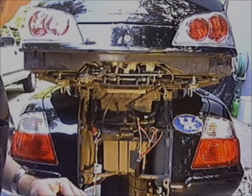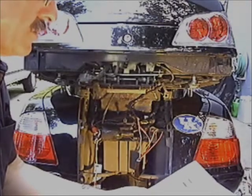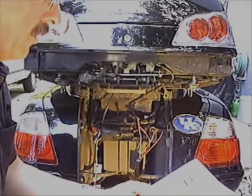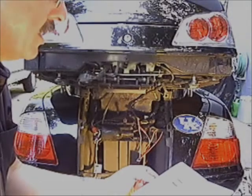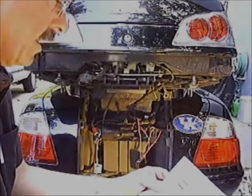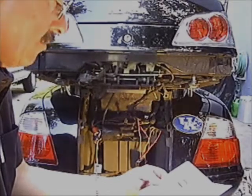Next step: read the two mode descriptions and choose how you'd prefer your brake lights to modulate. Once you've made your decision, connect the orange or red wire to the other end from the right brake light. That's the one we just did, so I'm going to connect the red wire — choosing Mode 1 — to that connection right there. This time I'll use a non-shrinking butt splice connector, but I have some liquid electrical tape I can paint over it.